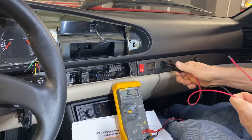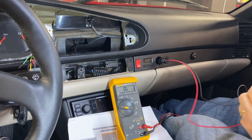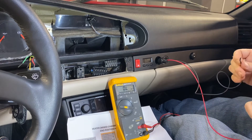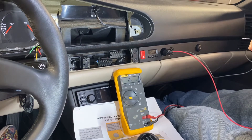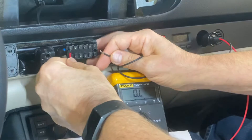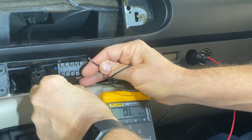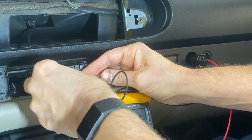This thing is just a convenient way to get power to test the motors. To test the heater motor, as an example, the chart shows to put power between A11 and A10. I tinned these so they're not all frayed wires. A11 and A10 — and listen for the motor.